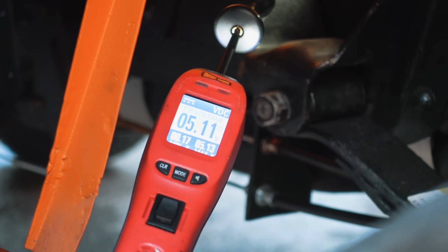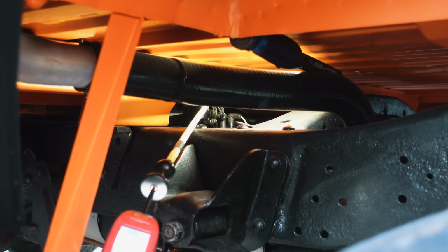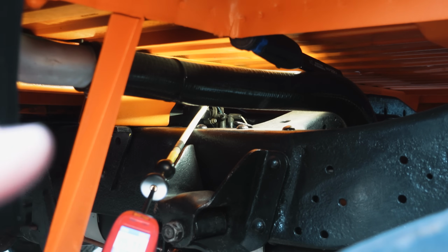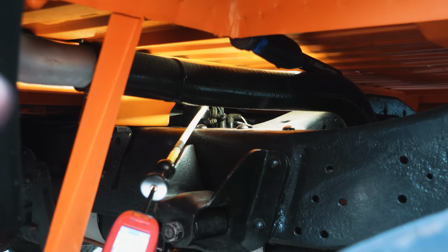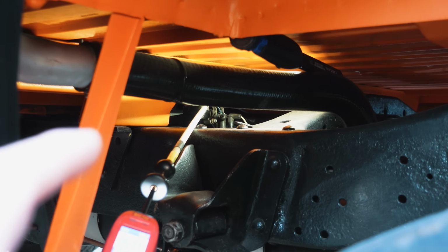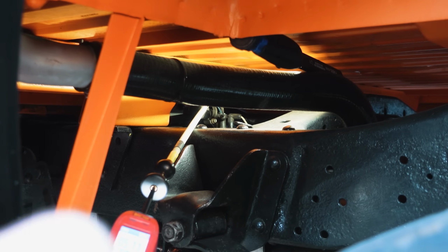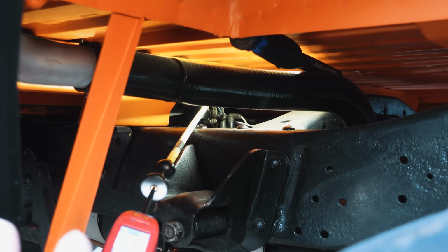No change there either. Now depending on your situation at this point, you could unplug those 2 connectors, do a resistance measurement on the float itself. You should have something there. You should have some continuity. And the other thing you could do is you could take those terminals off, try to clean them, put them back on, but our problem is absolutely right here, okay?